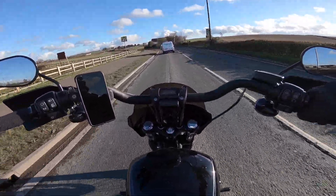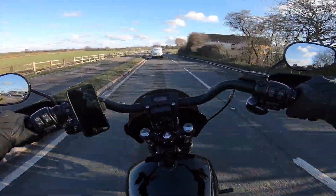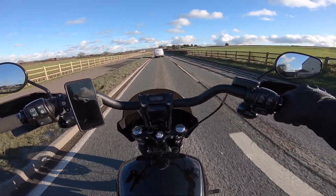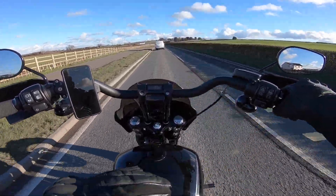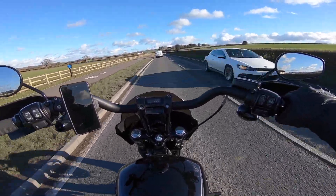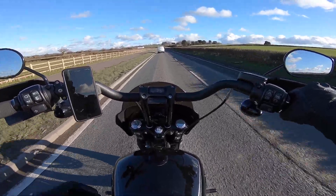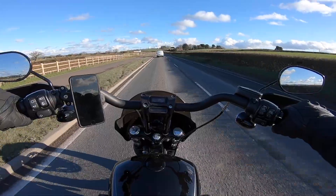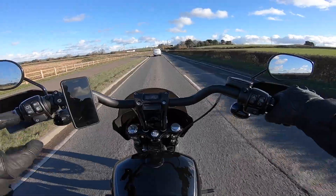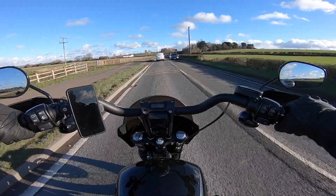So how do you run in brand new tires on a motorbike? New tires seem very shiny and slippery, and the idea of running your tires in is to basically make that surface rough. The rougher it is, the more grip you get. Unfortunately with a harder compound road tire, you're going to have to do quite a few miles to get that roughness to appear on the tire.